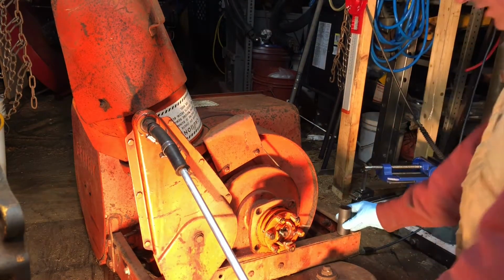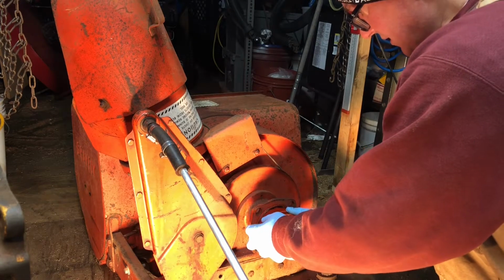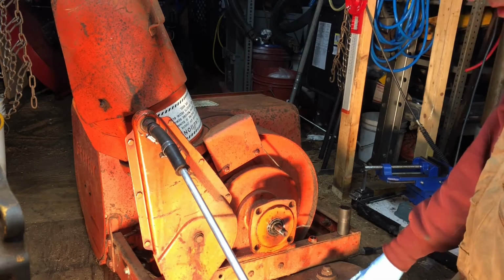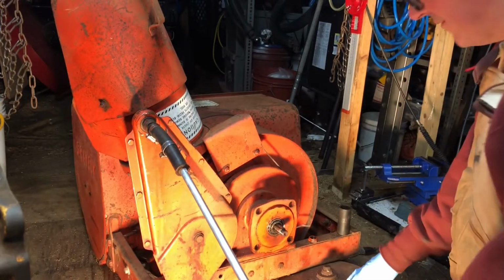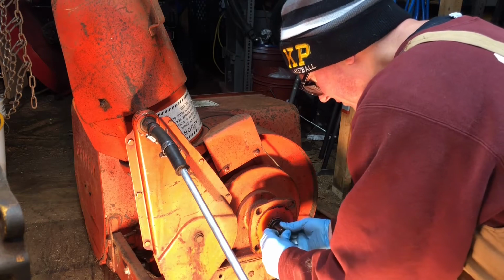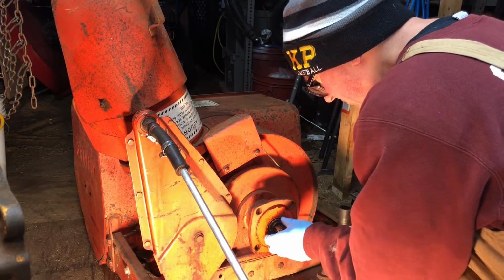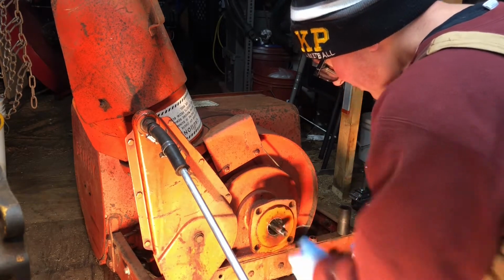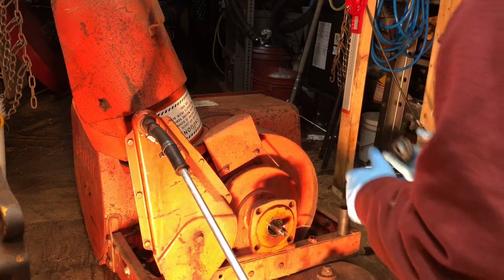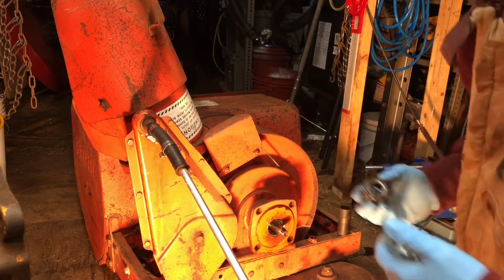I have the blower resting on these GRWs. I'll have to do a video about these and see if I can save those as much as I can. I'd like to save them if I can, but the one thing I am missing with them is the pinion gear, which is really the toughest thing to find for them. So, all right, let's see if I can get this thrust washer out. The thrust bearing looks good. I want to put this on something that's clean, because this is in good shape. I don't want to get any grit in it.